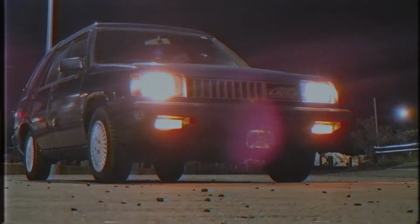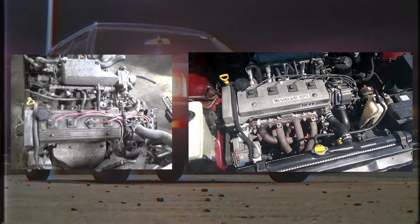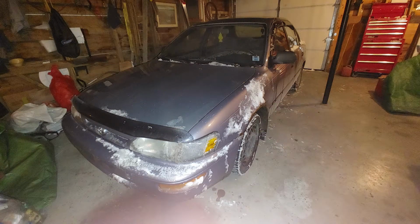This led me to my final two options, the 4A-FE or 7A-FE. Both use 6-bolt flywheels, both are very common, and both have been swapped into Tercels before, meaning I have a backlog of info to fall back onto for answers. These engines can both be easily found in 1993 to 1997 Corollas, so with that I picked up a donor car. This here is a 1997 Corolla DX.